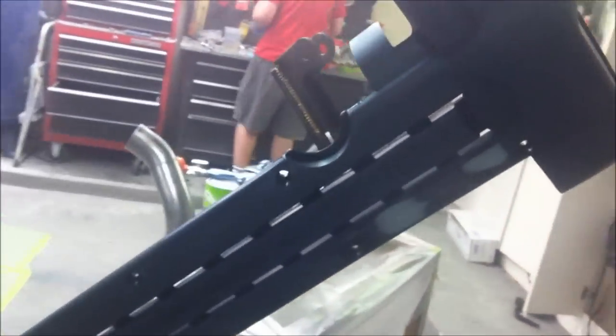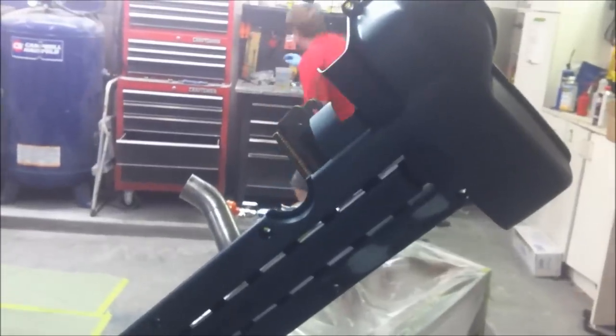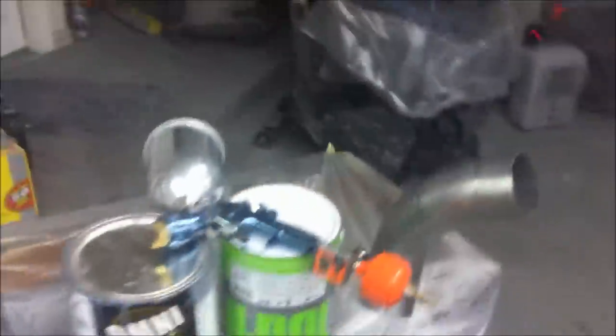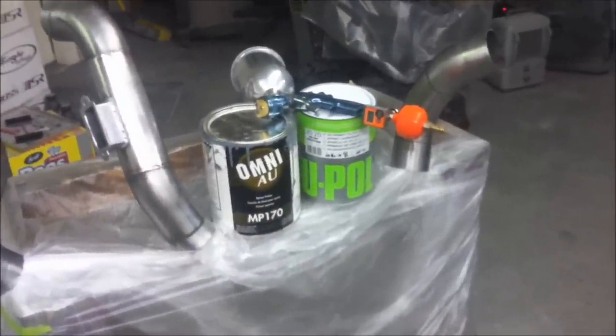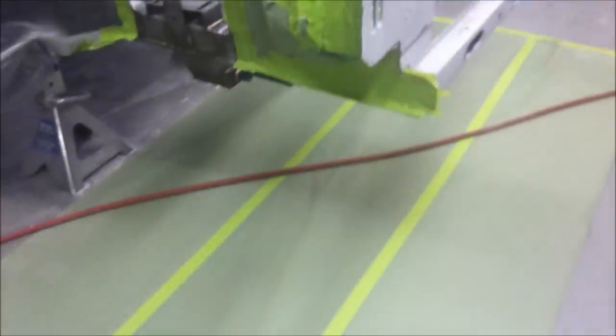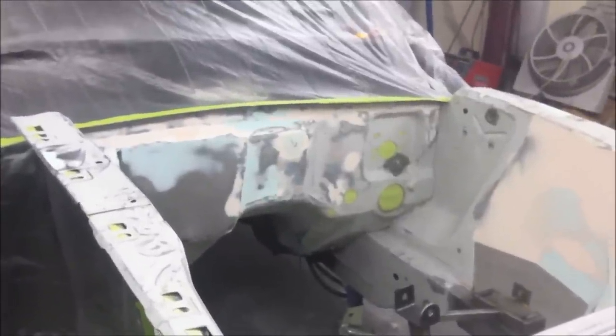The one thing about this is we had to put a little bit of body filler on a couple of deep scratches in the plastic, and I sprayed adhesion promoter over that. I looked at the tech sheet and it didn't really specify if that was allowable or not, so hopefully that's not an issue. But anyway, we're gonna epoxy prime this and these intercooler pipes, and also gonna put the sandable 2K primer. We're using U-pol primer for that, and that'll go on all that stuff as well. So we want to get it sanded out smooth for a nice surface. And we just put some paper down on the floor just to keep dust down, and I've also got to get up underneath there to get the bottoms of the frame rails and our cross member. So anyway, all right, well, that's it. We'll go ahead and get it sprayed now and show you what it looks like when we're done.